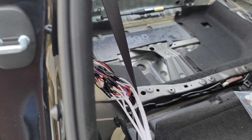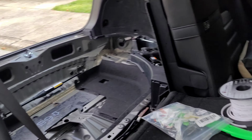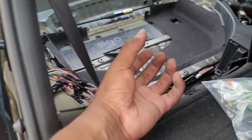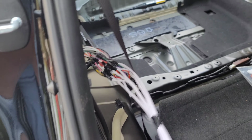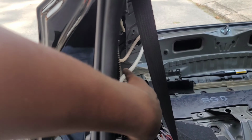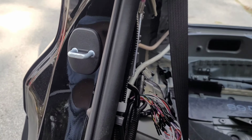Now there are 3 dash speakers in my car. There's 3 dash speakers up there, and those are weird because they are a mid-range speaker, or they're coaxial design, so it has a mid-range and then it has a tweeter built into it, so it's a coaxial speaker. And the setup that I'm running is three-way, so door speaker, a tweeter, and a mid-range, all separate components. So the factory amplifier, I believe, has the crossover. It's the built-in crossover here, if I'm not mistaken.